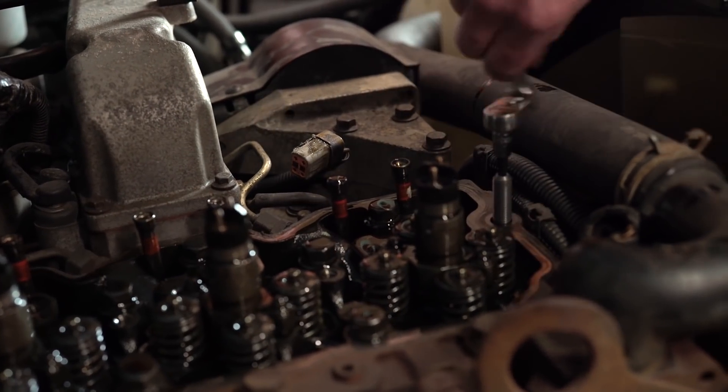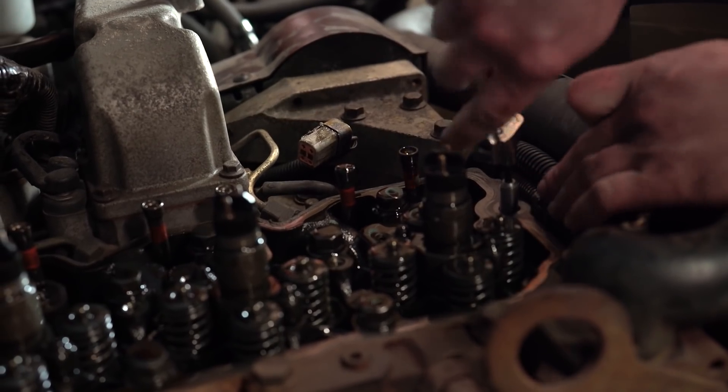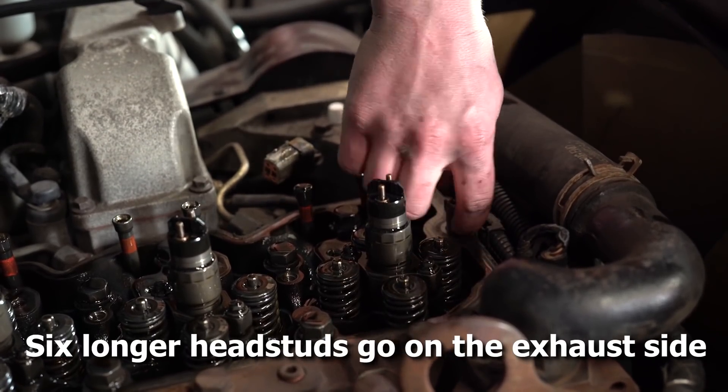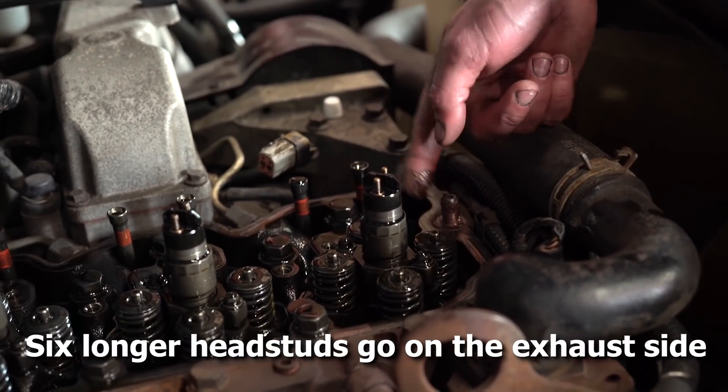You'll notice these have a star drive on the top, not an Allen. Stars are a little better about not stripping — that's a nice little upgrade they put on these studs. We're putting them in, going down until the bottom's out. Some guys like to back them off a quarter turn; we just like to go down snug, hand tight, so that they don't move around as you're getting up in your final torque sequence. We found if you back the studs off a quarter turn like you would for an ARP, it seems like they do a big jolt right at the end when you're torquing them. We just run them down to the bottom snug. We're going to put a little bit of the supplied lubrication on them — it adds corrosion resistance and helps them go down in the block nice and clean.